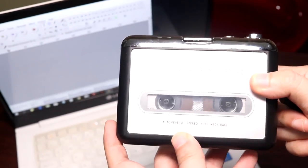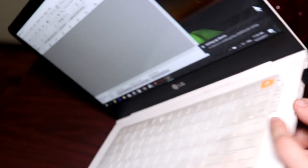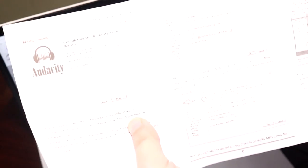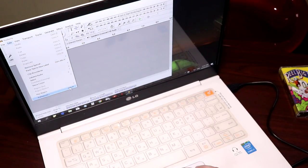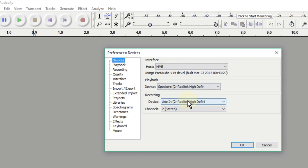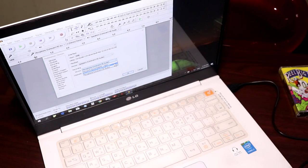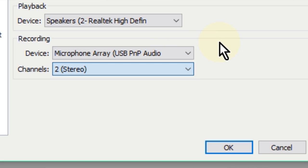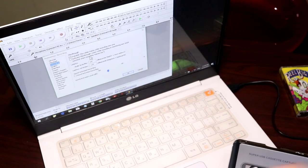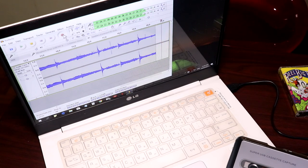The tape is moving. I'm going to plug in the mini USB — plug it in here. It's plugged in. I'm supposed to go to preferences, then devices. It's not here — I'm going to restart Audacity. Edit, preferences, devices. Now it's here. I shouldn't have opened Audacity before plugging this in because the input wasn't detected earlier. USB PNP audio — I'm going to click that. The manual says in recording I have to click software playthrough to listen while recording. The sound is now coming out of my computer speakers. Amazing!